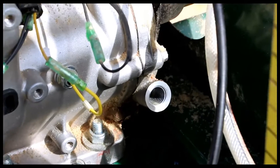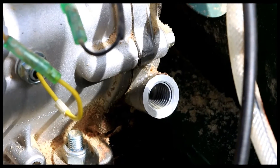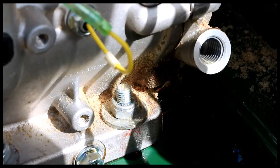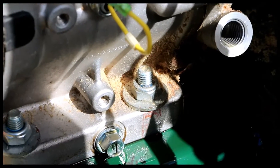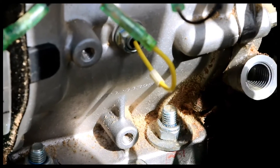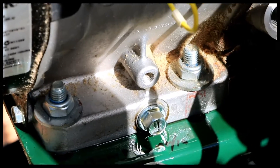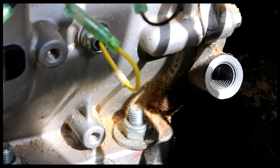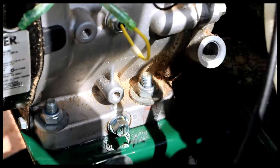You fill up the hole here until basically the oil overflows out the hole. The reason is because this is a splash-type oiling system, so the oil sits down in the base of the crankcase. You basically just fill it up good, put the top on, make sure the crankcase nut is tight — tighten it to 13 foot-pounds — and you've changed the oil.